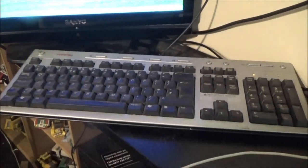But everything is working. I've got it to boot with both hard drives connected. It was a ridiculously simple issue that I found when I had a peek inside the BIOS. It seems on that particular motherboard, you do have to set the boot order. And all I'd done is put the SATA cables on the wrong hard drives. So what it was seeing as the first hard drive to boot from was actually the blank drive, hence why it wasn't booting. As soon as I shut it down and swapped the SATA cables around, it booted. So, that is working, technically.